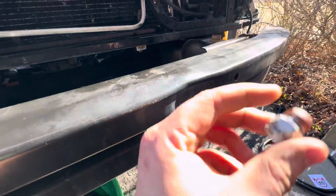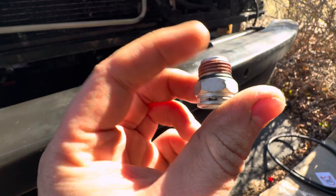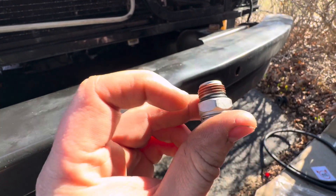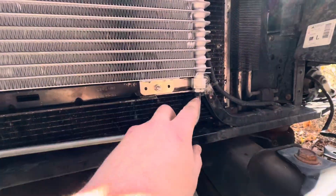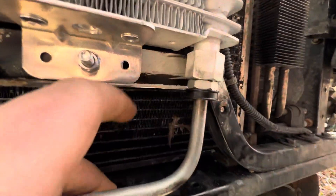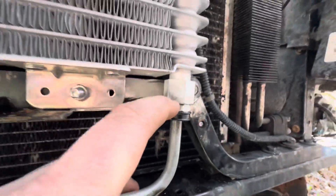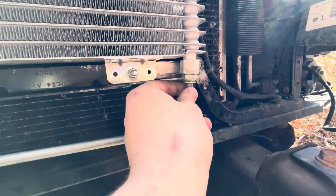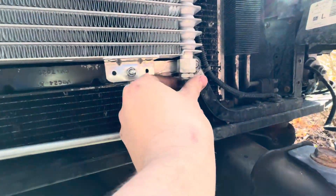So you'll need one of these, and you'll need an O-ring like this, because this does not seat all the way against the inverted flare. Keep that in mind — you need an O-ring on this. So you'll thread that in here into your trans cooler, and the O-ring shouldn't be poking out, should be nice tucked up in there, but it'll be tight. And then you can simply put your lines into that without modifying them.